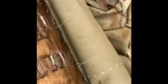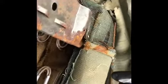All right, and then on the back side of the front seat too, I'm looking across the bottom of it, looking up at the bottom. Once you get your cover built, it first mounts under here. There are these nasty little hooks, very sharp, under there. And they hook underneath there originally. So that's where you start, is you get your wire piece. Let me get my pliers so I can see if I can pull that out.